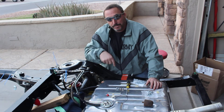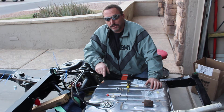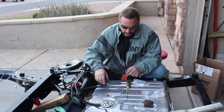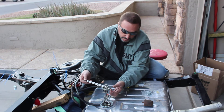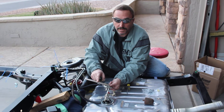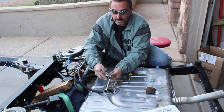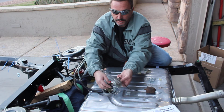If you look below, I have some links to some other sites. Hot Rod Magazine is really where I got this tip. Hot Rod's Online Garage was a great tip I got when they were doing their interview for their new host. So I chose this particular setup. I'm going to pull it out of the tank — as you can see, in this particular model, this is actually a vent line. But what you're going to see if you look at the Hot Rod Magazine link is they turned this vent line into a return line. And when they did the return line, I do want to highlight that.